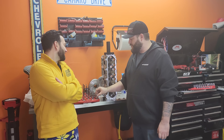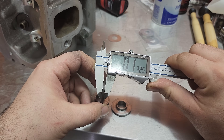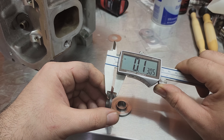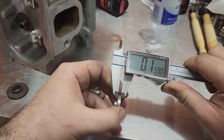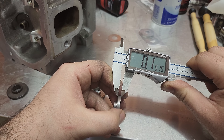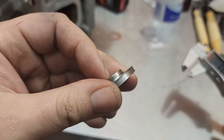What happens if you're not close to coil bind? The valve spring tends to float around. Here's a brand new valve spring locator — from inside to outside it's pretty flat, within five to ten thousandths. Now here are the ones that came off the car. This one, as you can see, is measuring 159 on the inside and 151 on the outside — so this thing was getting beat up so much that it was actually pushing material off the edge.